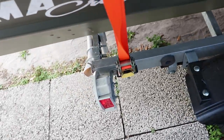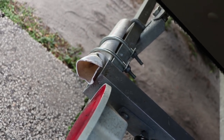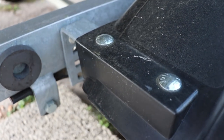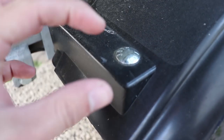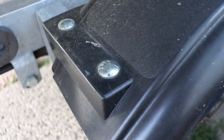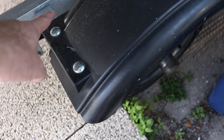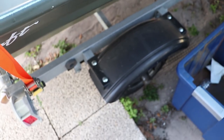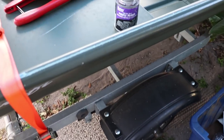This is the wheel — this is the end of the trailer here. As you can see, my older ones snapped off. This is where I want to mount them now. It's just a carriage bolt with a nut on the other side, pretty small. I went ahead and got 2.5-inch stainless steel bolts with a lock washer on the back side, and I just plan on mounting it here, coming across, and then 90 degrees straight up. So that's what we're going to have fun making. It should be simple, inexpensive, easy fix for this John Boat.